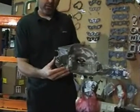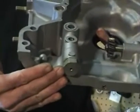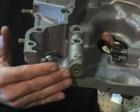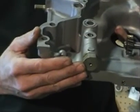Hopefully that was helpful. Remember, that was only one small modification of an entire package, and if it's not all done properly it may not give you the results you want. One further tip: remember when you modify the regulator to also shim up the front pressure regulator. This can be done by removing the nut and adding approximately an eighth inch of shim, and this is necessary to keep the front pressure regulator from venting too early and keeping you from building oil pressure to its maximum. Please join us for the next installment, and remember you can find these video clips and more at rotaryengineillustrated.com and specialty tools and more at pineappleracing.com.